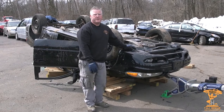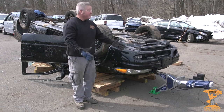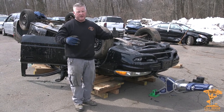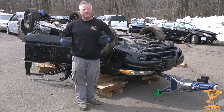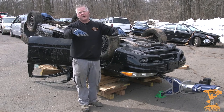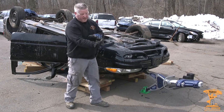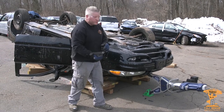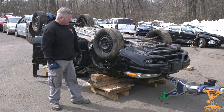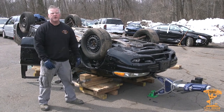All right, just to recap what we did here, we did a short axis, single point parallel lift. Our objective was to get the whole nose of the car up evenly because of the way that our victim was positioned. We couldn't really do a tilting lift. We opted for a parallel lift. Some important points: we counter-cribbed the rear with the step chocks under the roof rails there. We did a little bit of progression lift here just to create some ground contact to get the tool in deeper. And of course, we stabilized as we went. But at the end of the day, you can see we were able to get more than sufficient height to extricate the person in a timely manner.